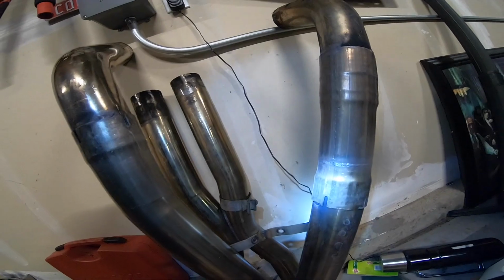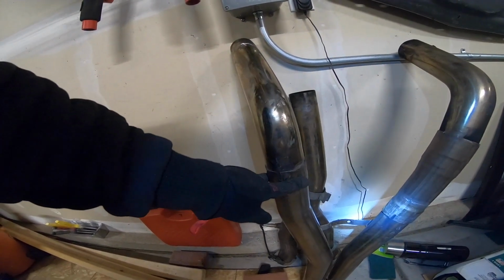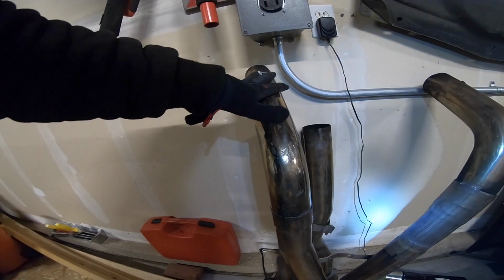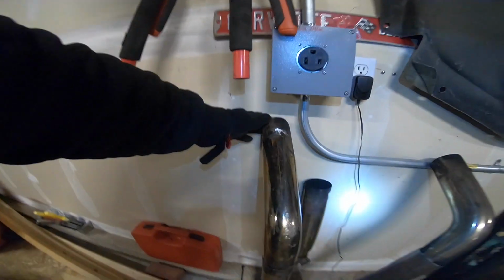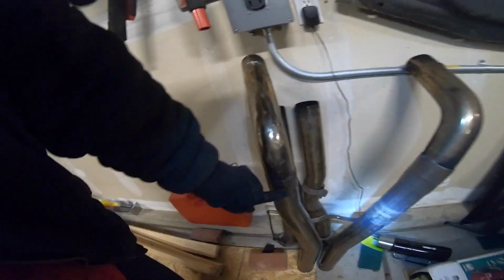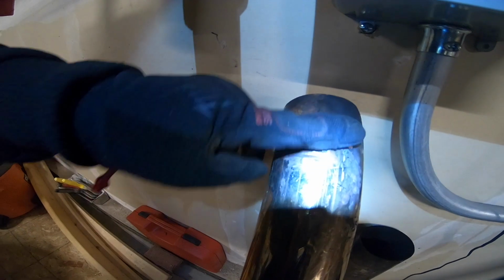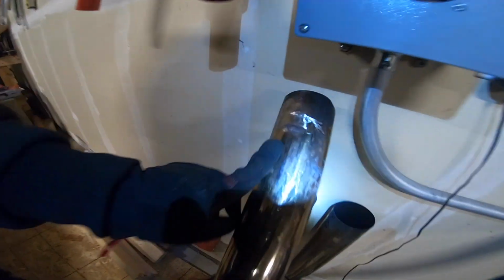What you're normally supposed to do is these go over the axle. They come down to a clamp right here. You unclamp it, you separate it, and this is one piece to the muffler. But for some reason, they cut it up here, and on the muffler side of the pipe, they put a piece kind of like this, but it's metal. As you can see, it's rusting right there. So they did that, and they also tack welded it.